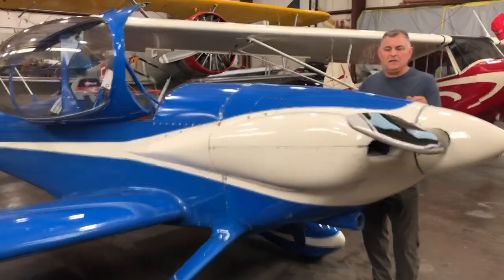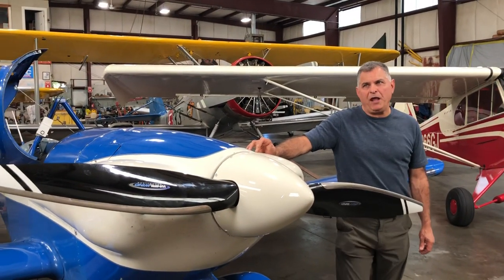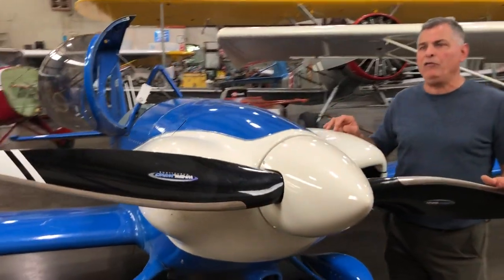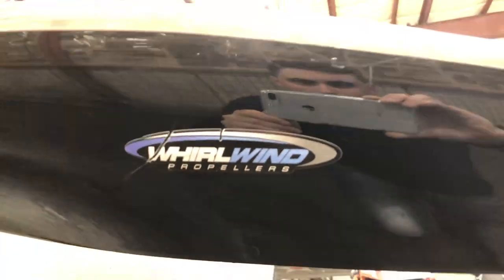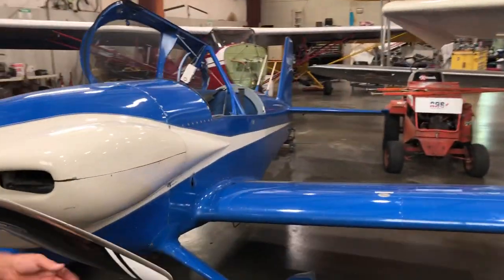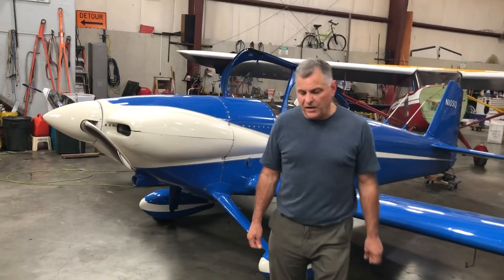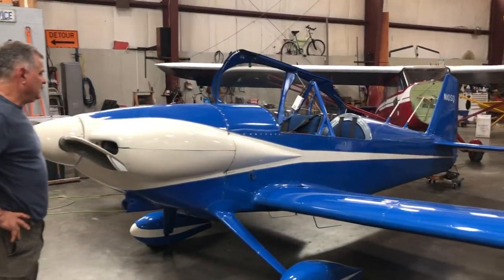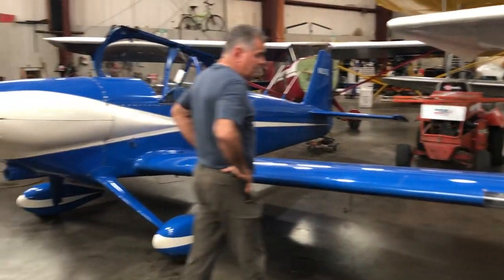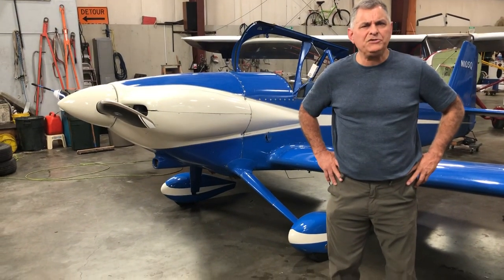These were 160-horsepower cylinders — brand new Lycoming steel 160HP cylinders installed at about 400–430 hours prior to our overhaul. It's been good and hasn't had any major issues. It flies to the Carolinas or Dayton, Ohio maybe once a month. It's really efficient — cruising at around 147 knots at not quite eight gallons an hour.